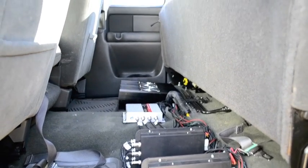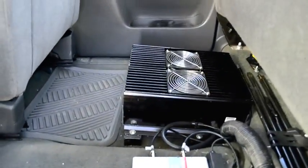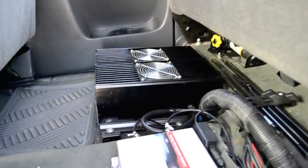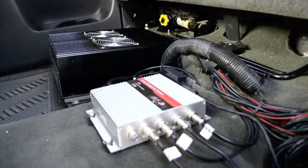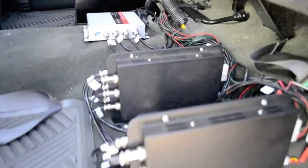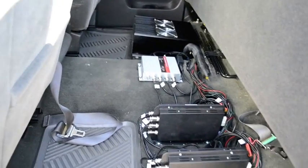Here's our charging system as well as the BMS. The charger is the far unit on the other side of the truck. It is a TC charger and it's rated for 96V with a peak of 130. The silver box is the CCM — central control module — and the four black ones here are the DCMs. They retrieve the data, send it to the CCM, then the CCM converts it and moves it up to our panel up front where we were getting all of our readings.